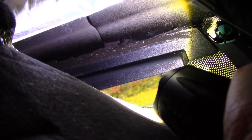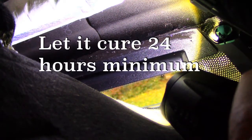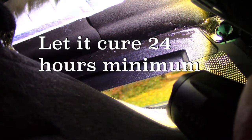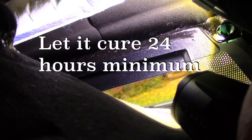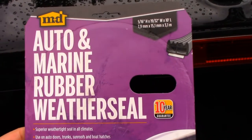Now that you've got it down, you can get underneath here. I found that my leak was happening right under here — right under this glass. I don't know if you can see where that silicone is, but I went ahead and just ran a bead right there and smooshed it up in there with my finger. Honest to God, it stopped the problem. It took me a while to figure out where the water was coming in. I was getting a couple drops in through the back — it wasn't the third brake light, even though I went ahead and bulletproofed that as well.